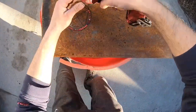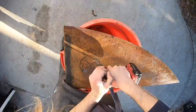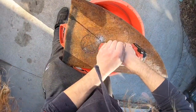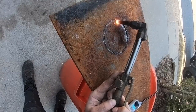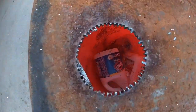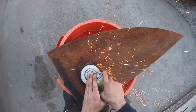I did say I was going to record me making the motor mount, so here's the video of that. To start off this motor mount plate, we have to drill a hole through this metal plate, which I did by using a drill bit and drilling a million holes. So we're going to drill for a little while because this took a long time. Then I got the torch and connected all of the holes that I just drilled.